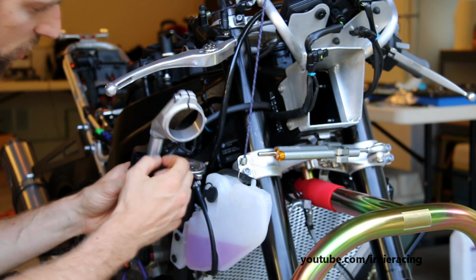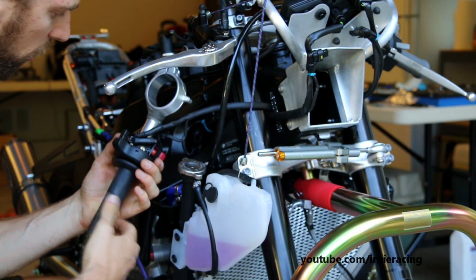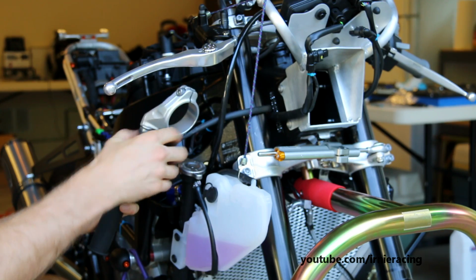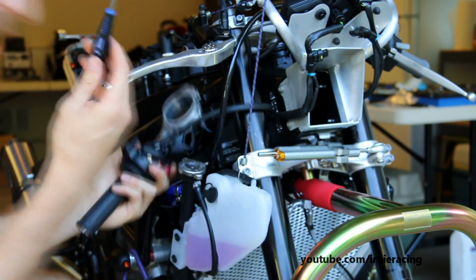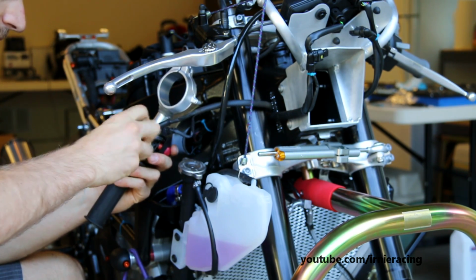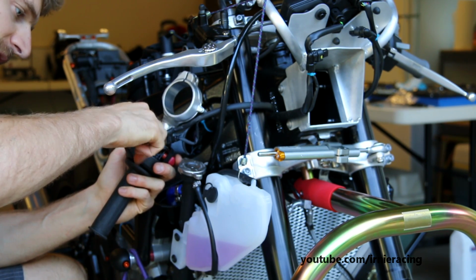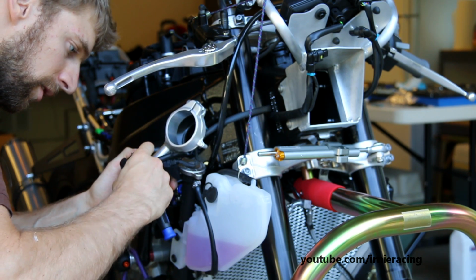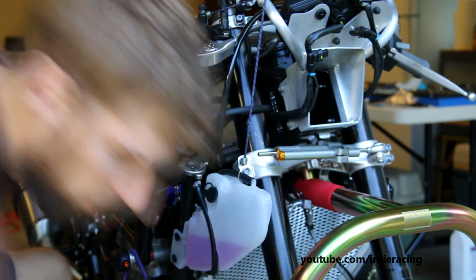To the throttle side. So pretty much you unplug the throttle, the quick turn throttle, the electric throttle, and then you remove the one cover. You remove one bolt and then remove the cover. It kind of just snaps off. And you need your long little Torx, the Torx 10. And now I'm removing this one center bolt. I'm trying to get it off the clip-on, of course. It's a little tricky for sure. Don't lose your bolts.